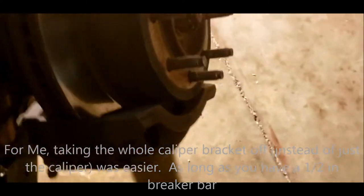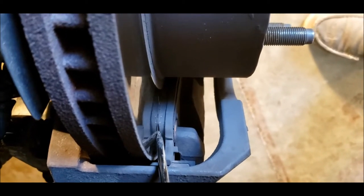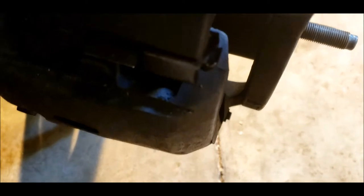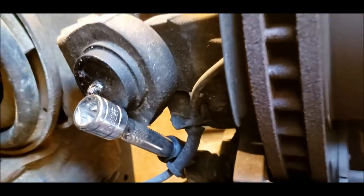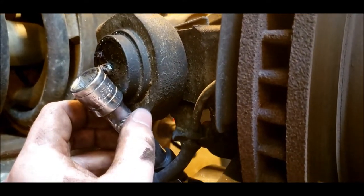Usually that doesn't do it, so you're going to have to hit it a little bit with a mallet to try and loosen it up. I'm going to try it on this side and see how it goes - I took the bracket off on the other side so I'll let you know which one's easier. Take a flat head, but you don't want to put it right there because you're going to damage your rotor and maybe your brake pad. You actually want to push here on the frame of the brake pad and just flex the screwdriver a little bit, going around in as many places as you can. There are access holes on the back side to do it. You're not actually going to see it move at all because we're talking about just a hundredth of a millimeter here - the point is just to break it off. Then I used a socket extension set on the frame of the caliper and hit this end with the mallet a couple of times. You can hit it pretty hard, not a big deal.